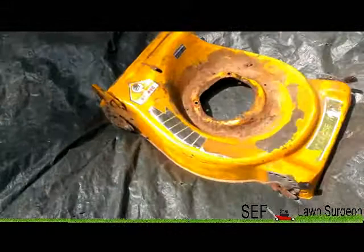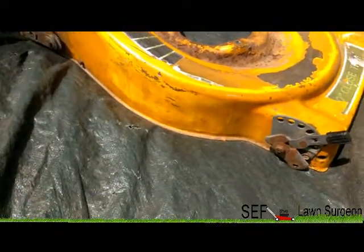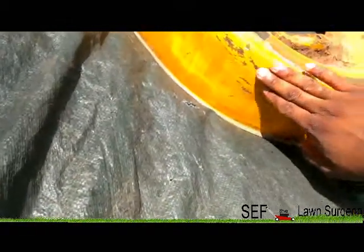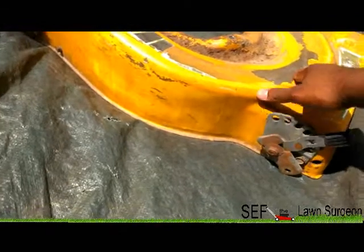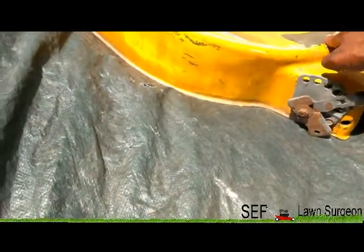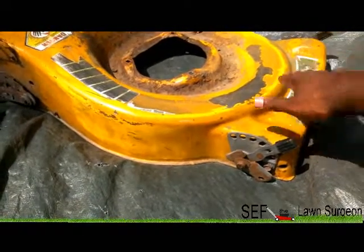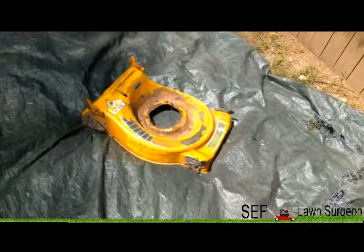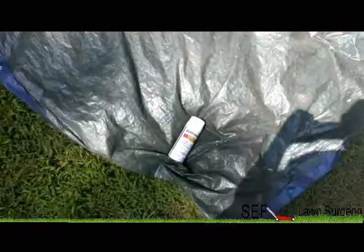Back again - I sanded this down. You don't really need to sand all the paint off since you're painting over anyway, but you want to hit the rusty areas with a real fine grit sandpaper and sand it down smooth so there are no divots. If you spray paint and realize you need to sand more, you can let it dry, re-sand, and paint over it. It's whatever kind of project - I'll probably end up keeping this anyway.